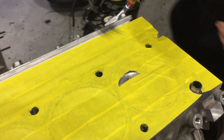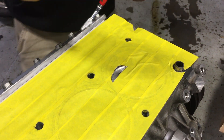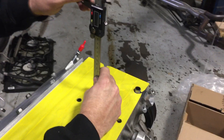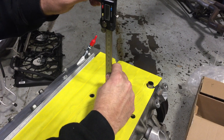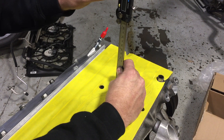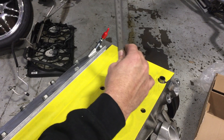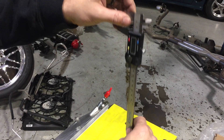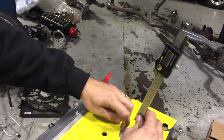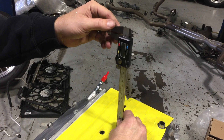So we like to verify our cut with a caliper in case you need to touch the cut up some. Sometimes they may wind up a little more shallow than you intended, so you may have to go back in there. 95 thousandths — check it three or four times and try to make sure you're in the deepest spot on the cut.